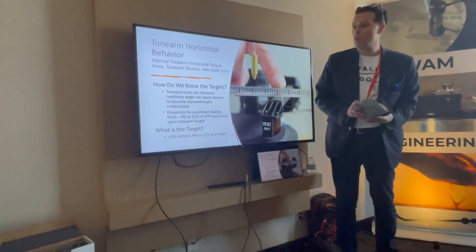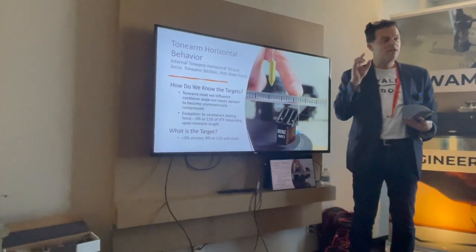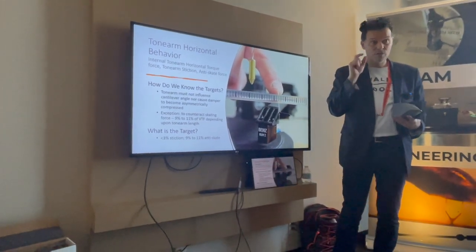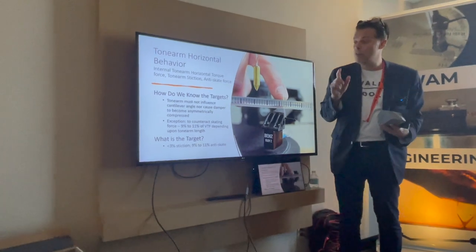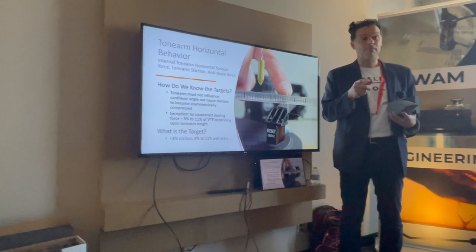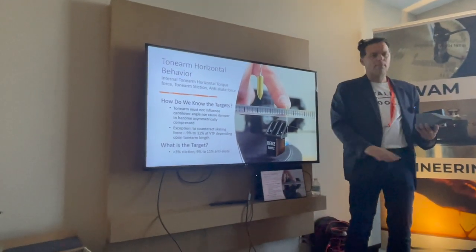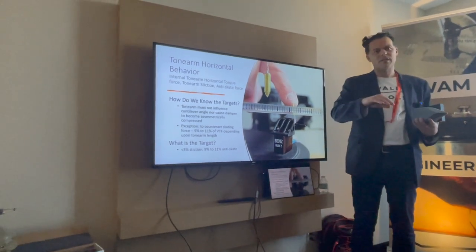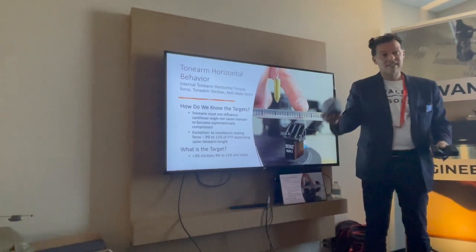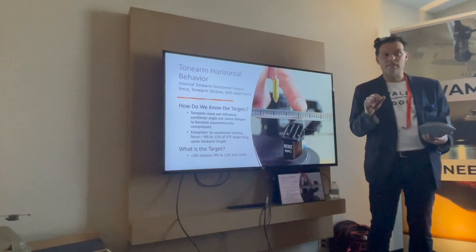All right? So the Wally Skater, my favorite tool, its purpose is to make sure that damper is able to do its function, and that those coils are able to do their function. It's easy to talk about how setting anti-skating properly avoids uneven stylus wear, but that's third-level importance to me. Second-level importance is let's keep the stylus properly oriented in the groove. Highest-level importance, let's keep that damper symmetrically compressed, okay?